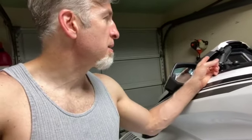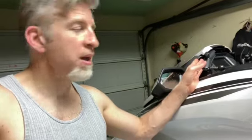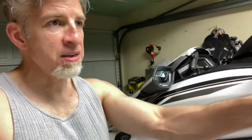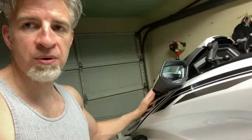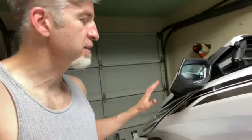With this automatic feed system, it's something I won't have to worry about. The gas will drain first from the back tank, which will continue to read my fuel gauge as full. Then as the back tank empties and the stock front tank starts going down, my fuel gauge will start reading as that one empties. So it won't mess up my fuel gauge at all. I'll show you step-by-step.